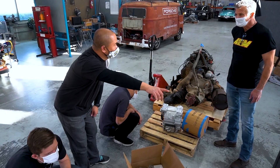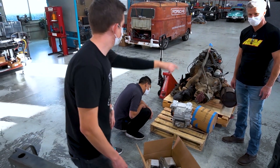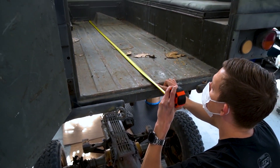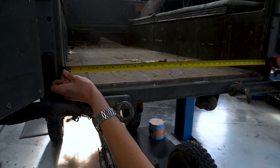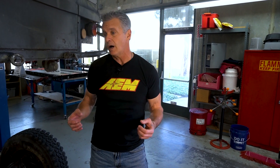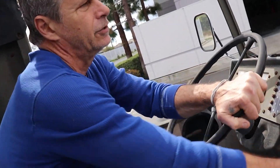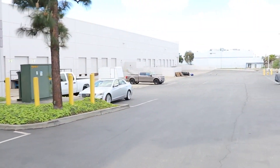Next is the battery — that was a big debate: belly pans, side pans, trying to figure out where we can fit it. We kept coming back to the floor pan area of the transporter section. It's a little over 32 inches wide and about 84 inches deep. When we mocked up our Tesla battery packs, just half of the pack fits those dimensions almost perfectly. We're going to stack the pack in the transporter area. It'll raise the center of gravity slightly, but this exercise really is to show the overall flexibility of our system. With the BMS and the genset integrated, the VCU can watch the state of charge, and if it falls below a certain threshold, the genset can actually kick on — range extender.